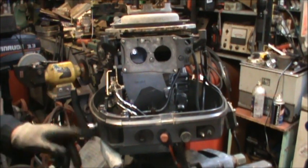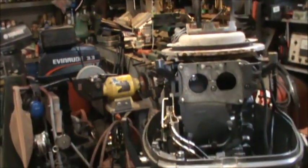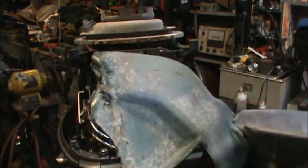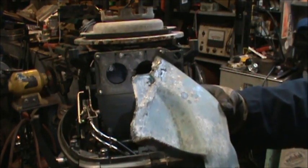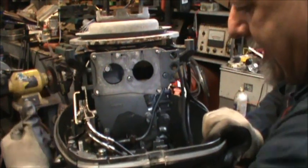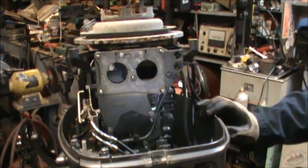So I need to zip this on out of here, clean this all up real good, put anti-seize on it real thick, and clean some other stuff up while I'm in there. I started on this hours ago, literally. And I'll guarantee you this is off an Evinrude Big Twin — you can see that Evinrude blue compared to the Yamaha gray. So that's a jury rig to begin with that didn't work, and there's weld here too. The Big Twins bolt up very similar to this one, so it was a good attempt but it failed in the end. But now I can get at this Phillips screw that's holding the clamp on the up-and-down shift rod.